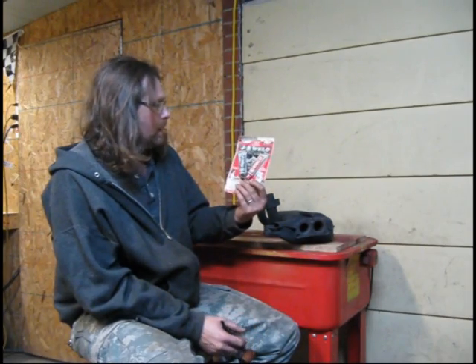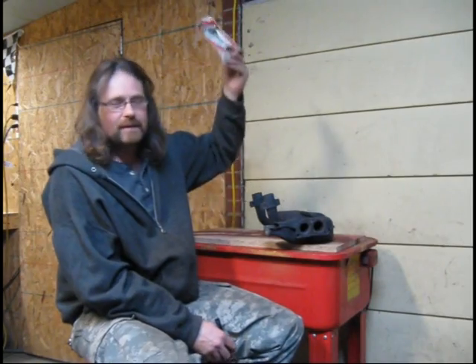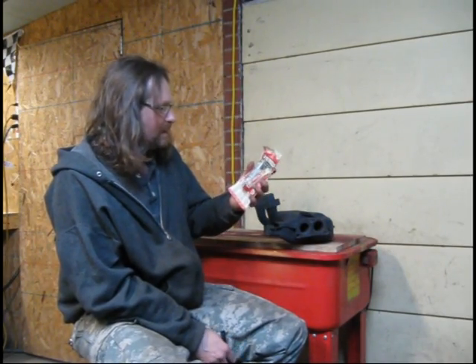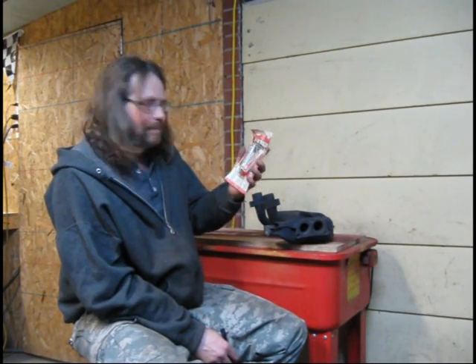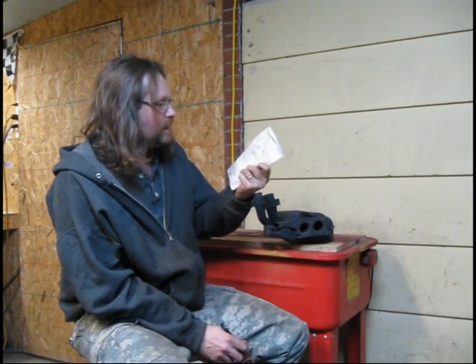Because they are so fragile, I'm going to use JB Weld. I'm not a big advocate of miracle fixes. When I was a kid they had advertisements about how wonderful these things were, like with crazy glue — they'd glue a guy's helmet and he'd hold on to a crane. I don't take stock in stuff like that. I've heard of people fixing engine blocks with it. My personal preference for a stripped thread in a block would be to use a thread insert, rather than fill it with this, drill it out and tap it.